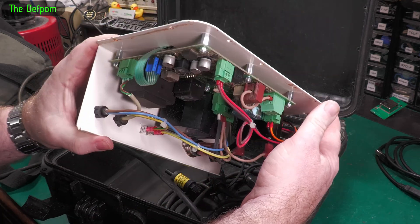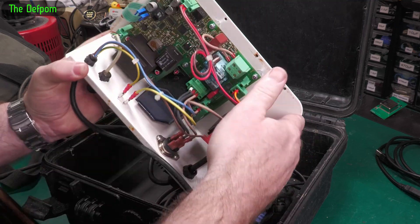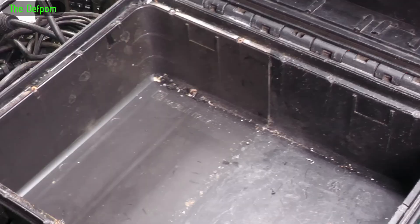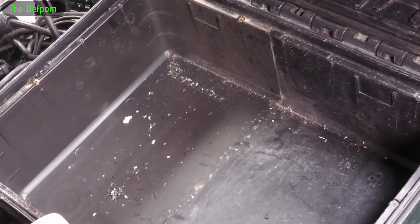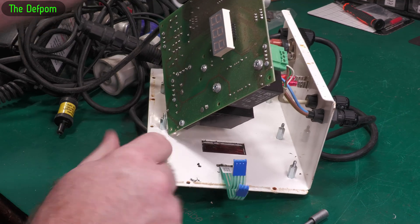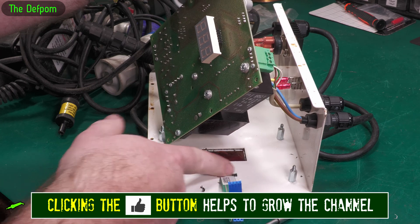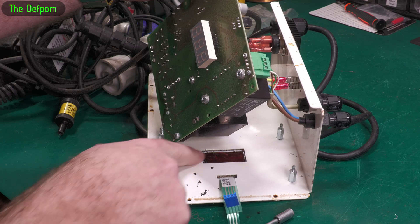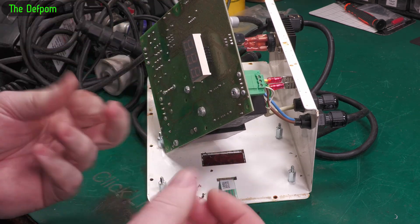I hope I can do it from the other side without too much trouble. It's hard to get a nut driver on this to take this board out, but it shouldn't be too bad. I'm going to take out the case first, clean the case out. You can see the debris floating around this side - you don't really want that getting in there; could get some bits of metal, all kinds of stuff. I've lifted the board out and there's a lot of dust on here and debris around that window where the flex goes through. This flex has the LEDs and push buttons for the front panel, so it definitely needs a clean.